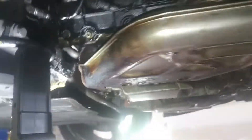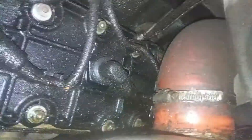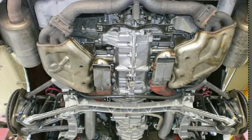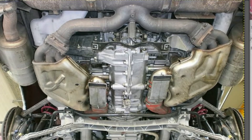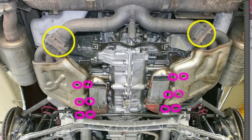This is the bottom of the engine. To take the cover off this gasket, it's better if you take the heat exchangers. Usually you should only need to take one because there is some space behind it where you can manage with skinny hands or a snake tool. In our case we had to take both. Each side of the exchanger has six bolts on one side and three bolts on the other. The six bolts are on the passenger side and three bolts are on the driver's side.